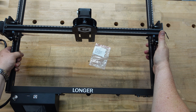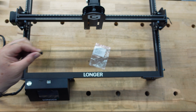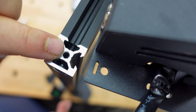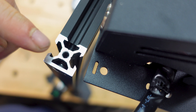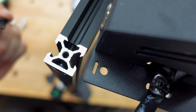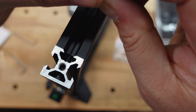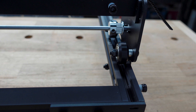All screws are the same size except the one for the screen corner. That particular hole wasn't threaded — I think that was a manufacturing error because there were no threads for the screw to grab. I used my tap set with an M5x8 tap. Since it's aluminum it was actually really easy. That worked perfectly, so now let's finish putting the screen on.